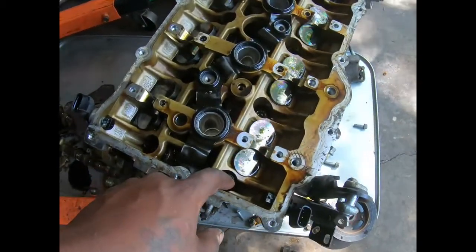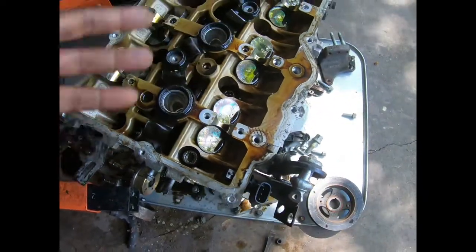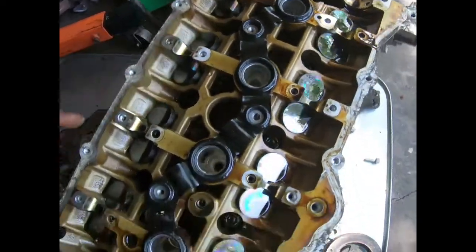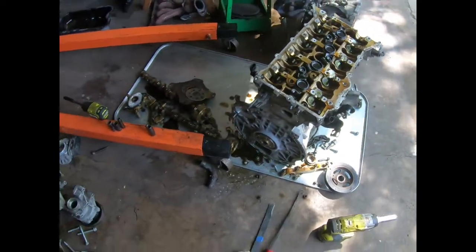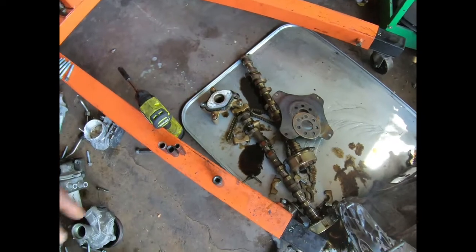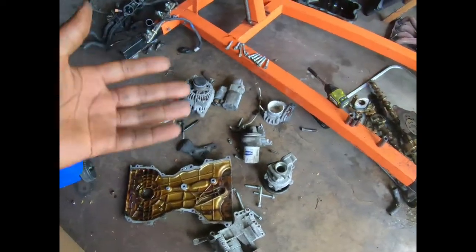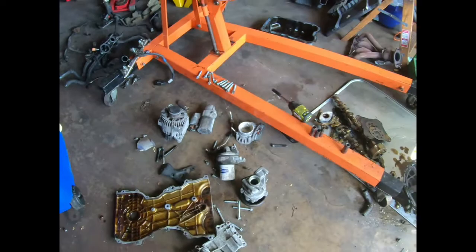And like I say, on these, this is triple square spline. Now I do have some, but they're not the impact ones. So I have to order those. I had to get the other ones up in here, these little bitty holes, because two up in there. So that one's stripped, that one's stripped, and that one is stripped. So hopefully I'll still be able to get the 12 spline on there when it comes in, but all the other pieces are ripped apart. They go to the cam. That other little special piece that sits up there, I don't know what that's for. All my parts, garage is a mess, all the parts from this motor. I'm gonna find somewhere to put it, but that's a wrap.